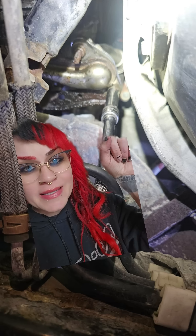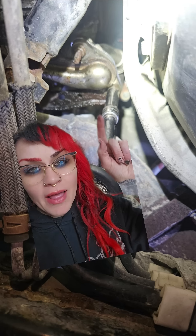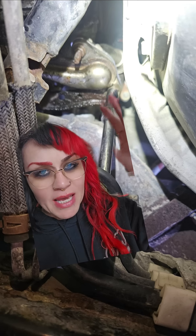What I do is smack with a hammer around the nut, and I'll actually hit the end of the extension and hit the socket — but I won't hit the nut itself, because I obviously don't want to damage the nut.